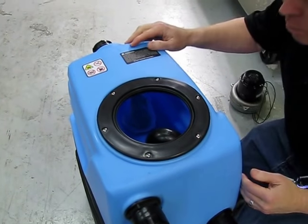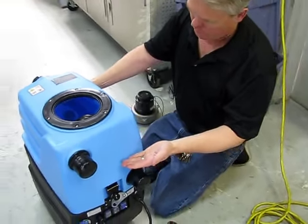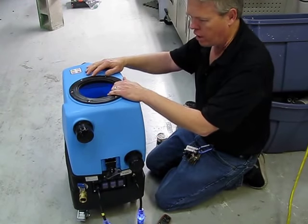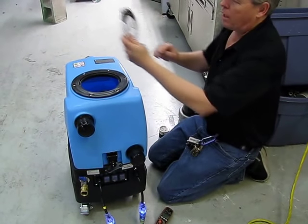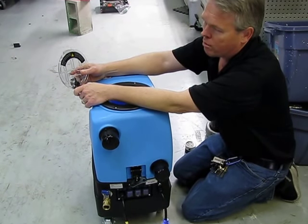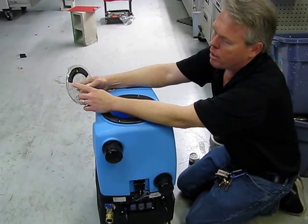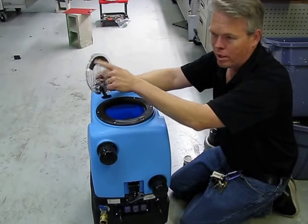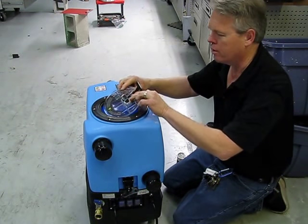Because of where the pickup point is on the top of this tank you really shouldn't get more than 50 percent full. So if you're going to use it as a standalone extractor, please empty it regularly. I notice on the cap there's a warning about making sure your recovery tank is empty before refilling the solution tank — well, that really doesn't apply to this machine; there is no fresh water tank. That's just a generic sticker referring to their other machines.